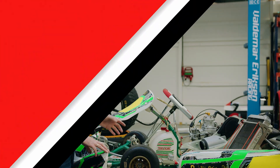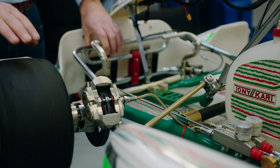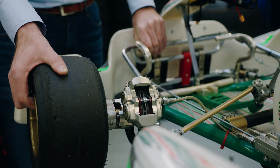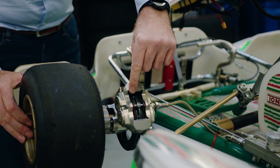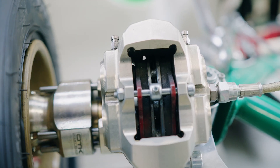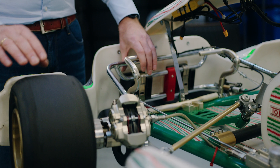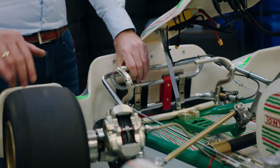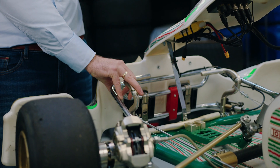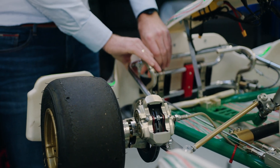When you drive down the straightaway, the disc is spinning, and when you press the brake pedal, the caliper pistons come out squeezing the brake pads against the disc — that's how friction stops your car. There are many variants with ABS and so forth, but the fundamentals are the same. On a go-kart demonstration, when I push the brake, you can see the wheel locks. When I release, the brake pads retract only hundredths of a millimeter — just enough not to drag. The pedal has two stages: a soft stage where nothing really happens, then it goes rock hard.